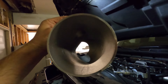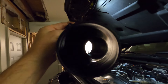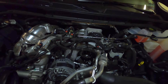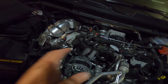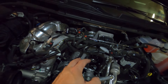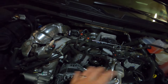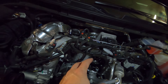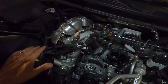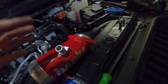Something else to remember: this is the suction side of the turbo — the side that connects to your airbox — so it's not under pressure at all. If you have a restriction on this side it's going to make everything else magnified as it goes through the compression cycle with the turbo itself, then through the boost tubes, through an intercooler. A restriction here is a much worse case scenario.